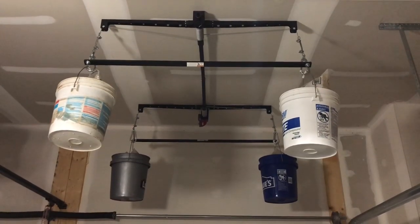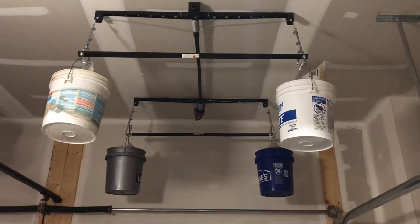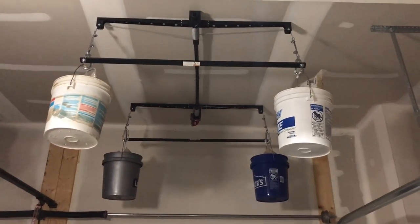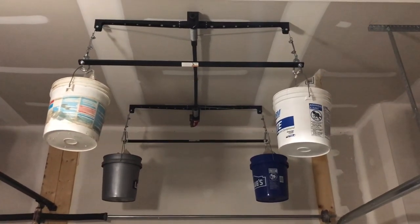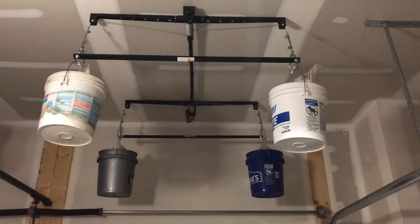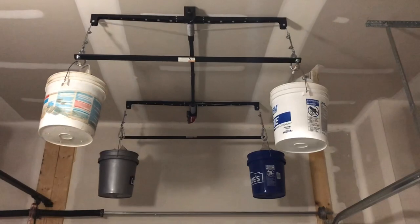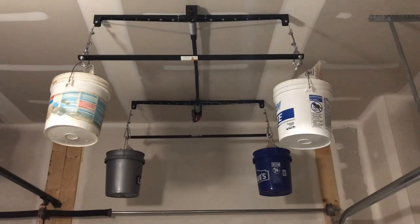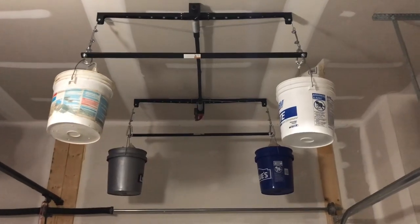I got the buckets up into the ceiling. I quickly gave up on the manual crank to get it up there because honestly, with the handle you really have to have good forearms and good shoulders — I've had two rotator cuff surgeries and it's just not going to work for me. So I switched over to the half-inch drill bit adapter and it went up great. Just make sure you have a fresh battery and definitely do not use a three-eighths inch drill — the bit won't fit and most don't have the torque required to lift 200 pounds. I'm going to go to bed and tomorrow I'll make sure everything still looks good — nothing settled, nothing separated from the ceiling — and then we'll raise the rooftop tent.